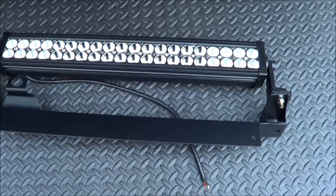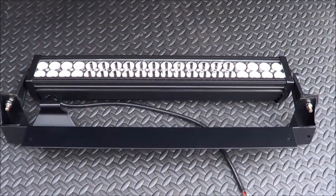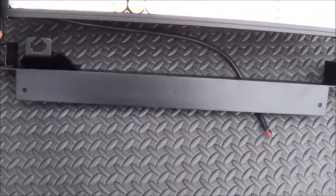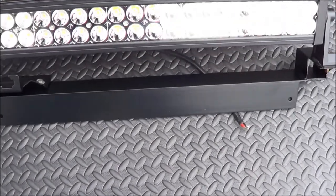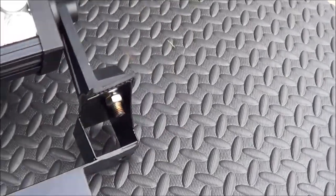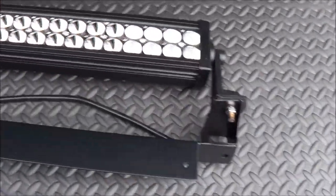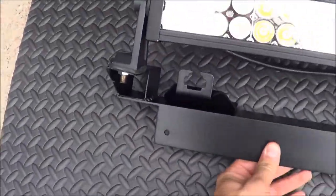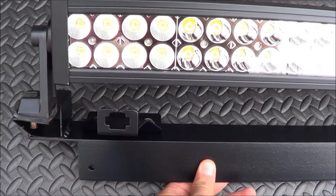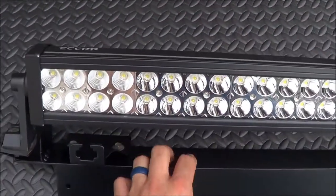Here is the light bar. It's a 22-inch light bar I bought off Amazon — I'll put a link in the description if I remember which one I got. It is mounted on some two-inch angle iron and some one and a half inch square tubing welded on top, and that is how I mounted it. There is the bracket for the block heater — I just unbolted that from the header panel, flipped it, and bolted it to this. I'll show you all that after it's installed.